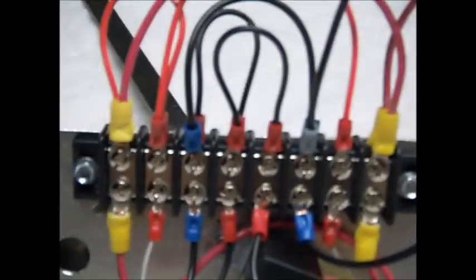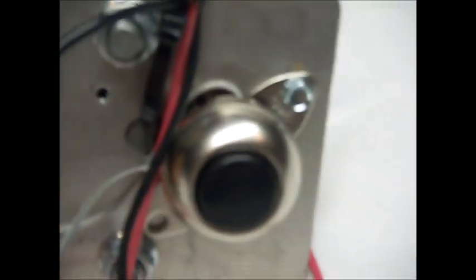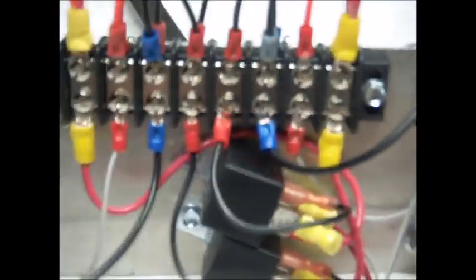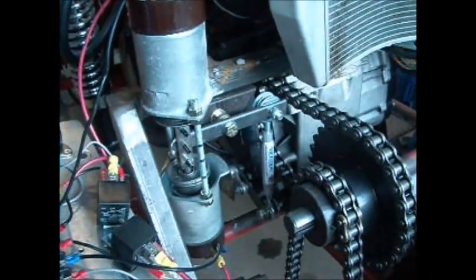There's all the wiring. You can see when I use the terminal strip, most things will just jump across — all the power is coming in on one terminal and jumps across to the others. Same thing to ground. The cheapo little three-dollar low-current switch running to a relay, same thing on this side running over to the other relay. And there you have it — shift all day long. Can you say electric solenoid shifter?